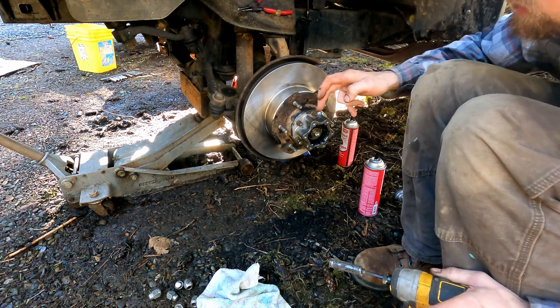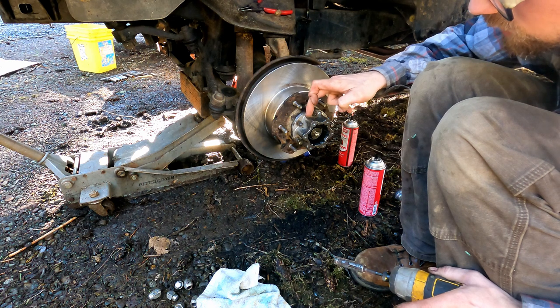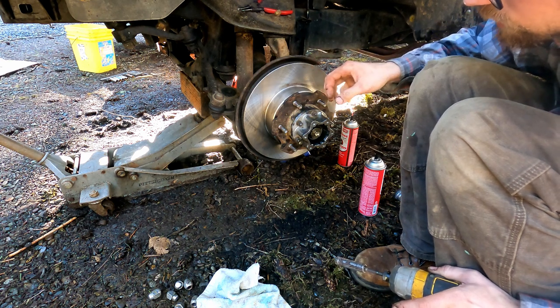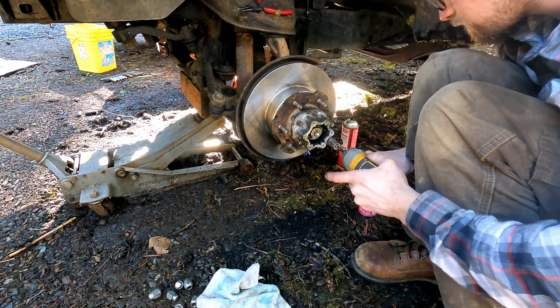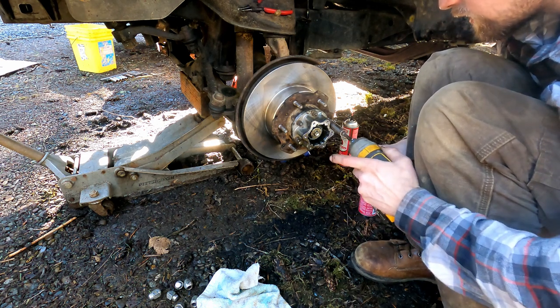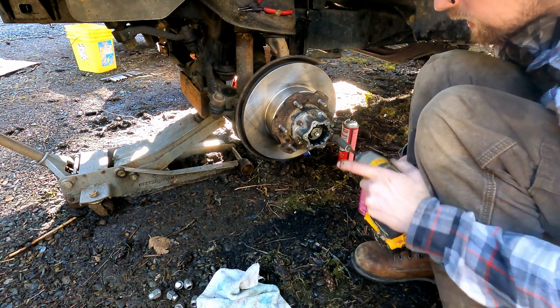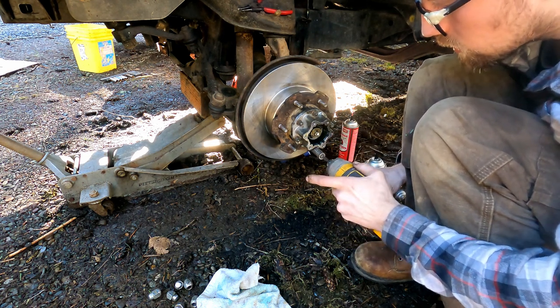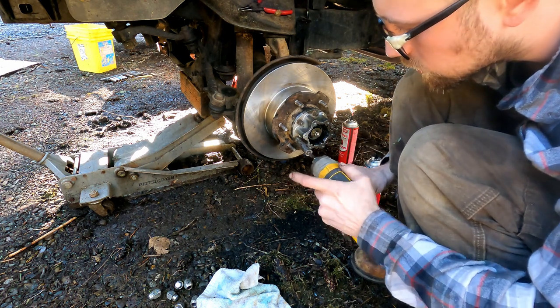There's also a gasket between the hub and the locking hub body. I just let those get greasy — it's just grease in there, it shouldn't leak. But make sure the gaskets are there and not ripped. Tighten everything snug — don't overtighten.